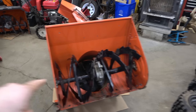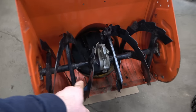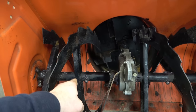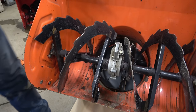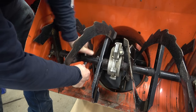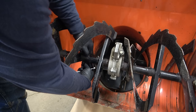On my machine I've got two grease fittings on each auger. It's a lot easier to work with the machine tilted up like this. Don't worry if you don't see the grease fittings right away — when you remove the shear pin you'll be able to spin the augers to locate the grease fitting. The better way to grease your augers is to remove the shear pins first.